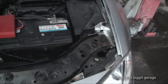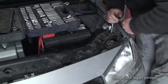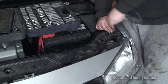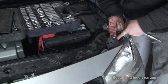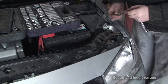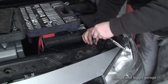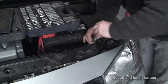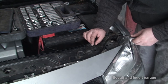I'm going to remove these few bolts first. What I want to take off first is these 13mm bolts — there's one at each end. There are also a couple of bolts hidden underneath the actual bumper which hold on the headlight, and a couple of Torx screws — they're T30. I'm not 100% sure what they're for yet because I can't quite see underneath, so I'm just going to remove them because they'll have to come off when I take the cross member off anyway.